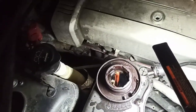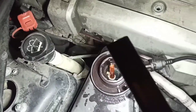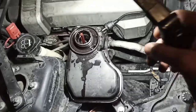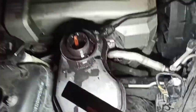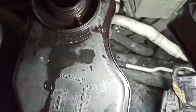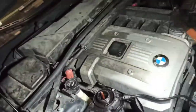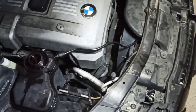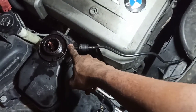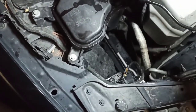The pump is now quiet; it may have finished its bleeding cycle. Looking at the float in the expansion tank, I'm already at the maximum level — when the float protrudes, that's the maximum level. I've gone through a couple of cycles of the water pump so I'm pretty sure I don't need to do anything else. To help bleed the system, you also need to unscrew the bleed screw on the expansion tank while filling it — you'll actually hear the air hissing out.